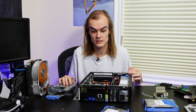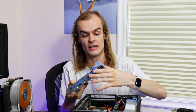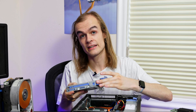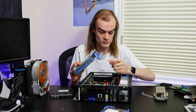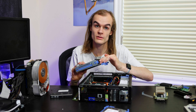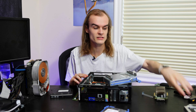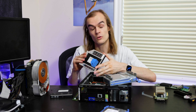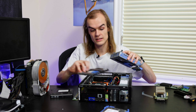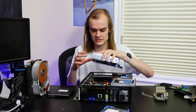Really the only thing left to upgrade is storage. There's a 500 gigabyte hard drive that came with it, and I can either put a larger hard drive in or an SSD. I have a two-terabyte hard drive with a Dell slide-in mount for more storage, but I'd also like high-speed solid-state storage. I'm going to use one of these adapters that converts a laptop CD or DVD drive bay into a two-and-a-half-inch SSD slot. This way I can put a one-terabyte SSD and a two-terabyte hard drive in the system all without using any extra SATA ports - though it does mean giving up the DVD drive, which I don't really use these days.